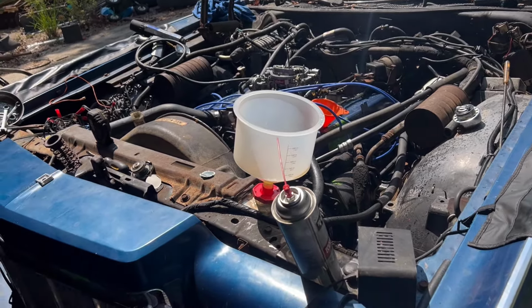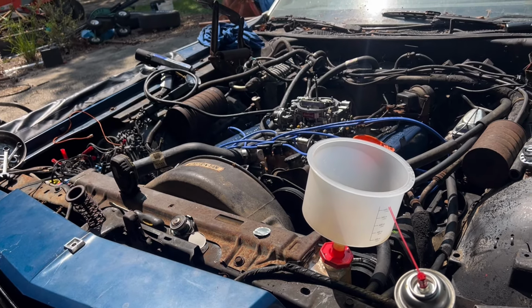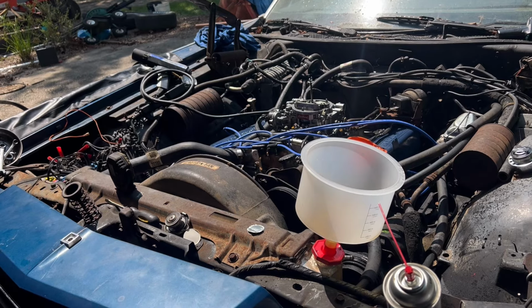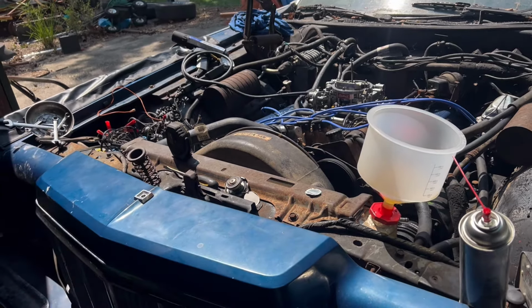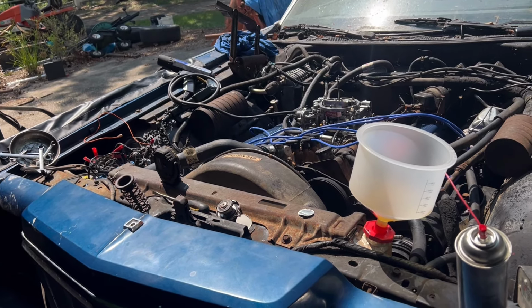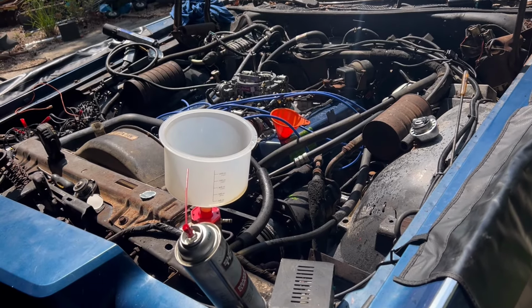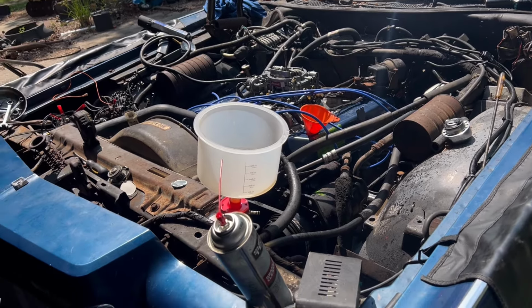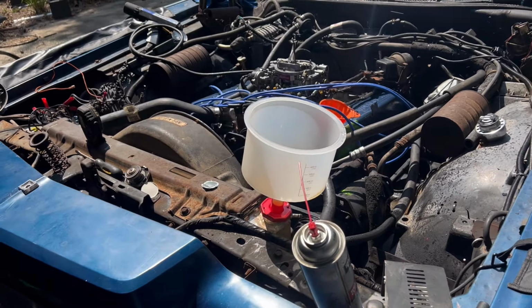We've now run this thing. I cut it off quickly, but it lost oil pressure twice. Not ran out of oil, there was oil in it, but it was blowing the pressure out the oil filter. So we lost oil pressure twice now. We do have a lot of assembly lube on this thing, so I think it's probably okay, but not ideal, and we were running this thing at higher RPMs for cam break-in. None of this was a good situation.